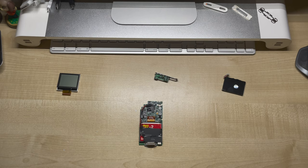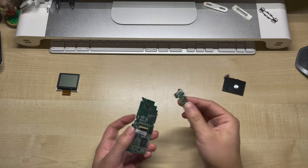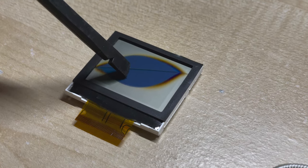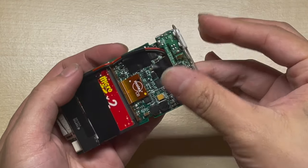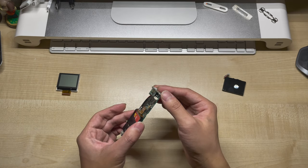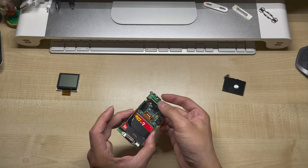With the Taptic Engine in, we can start finally putting everything back together, starting with the headphone board. Now there's something we need to be aware of — the headphone board requires a lot of pressure to properly reconnect, and that's the reason why we removed the screen. Because if we put it here and then push hard we'll definitely break the screen. So just align it and then push, and keep pushing until you can feel the click. The first time I was doing this I didn't actually press it in properly even though it looked connected, which is why the headphone wasn't working properly — it was making really weird noises. So if that happens that's probably why. Just make sure you reconnect it properly.